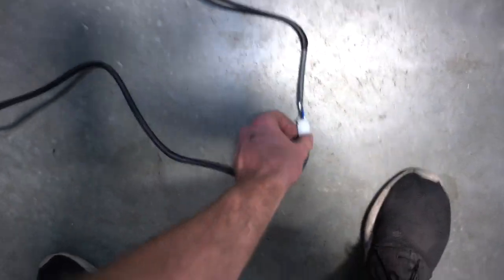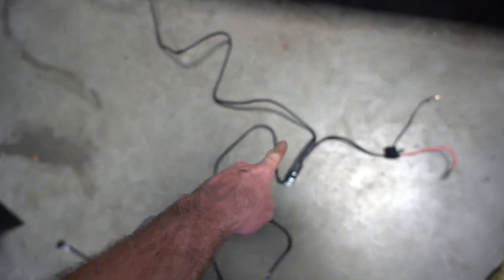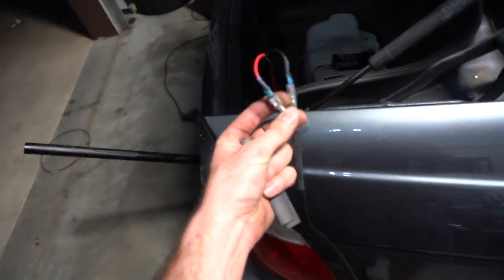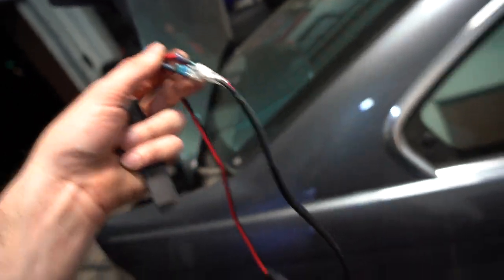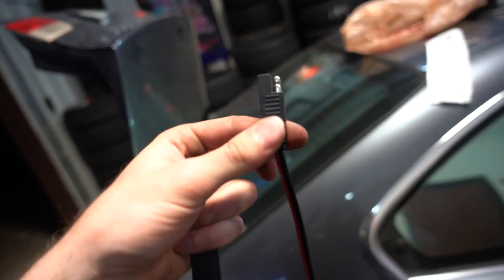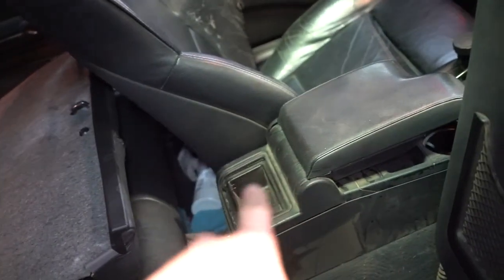This other cable is just a switch for on and off — it'll turn on and off the pump. Then there's one more coming up here which goes to your accessory, in our case the pump for the tank. The wire I spliced was the pump wire — I cut it and crimped on those little spade connectors so I could plug it into the Amazon wiring harness. That way I can unplug the pump if I ever need to. Now I'm going to mount that to the battery and fish everything up as far as I can into the car.